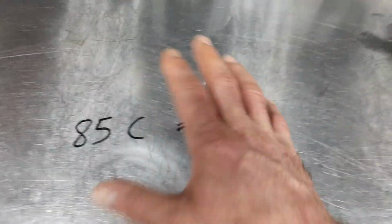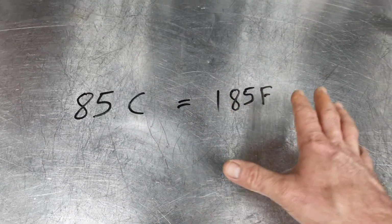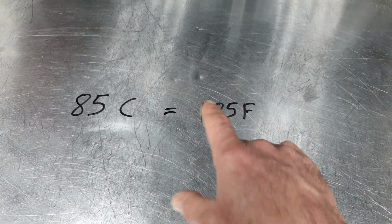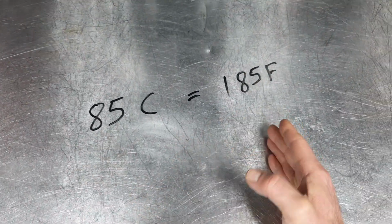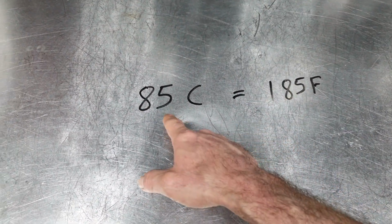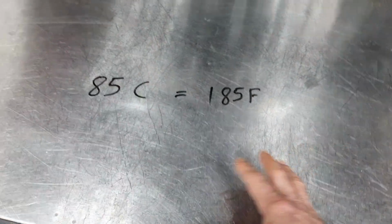Again, it's not good. It's not the ideal. It's okay to maintain, let us say, the temperature 90 or 92, let us say 95, not on the instrument cluster. On the instrument cluster, it shows you something between 90 and 94. It's never going more than 94. It never goes less than 90. But if you see that it drops down less than 85, then you cannot continue cruising the car.